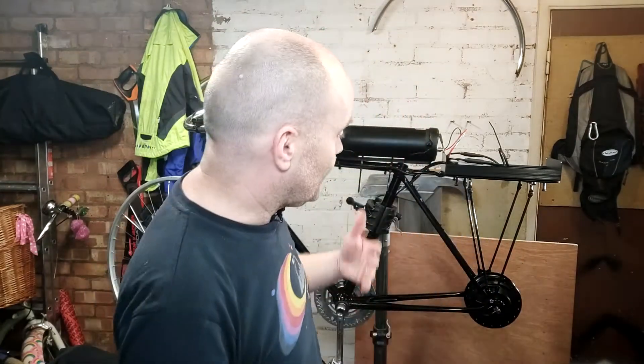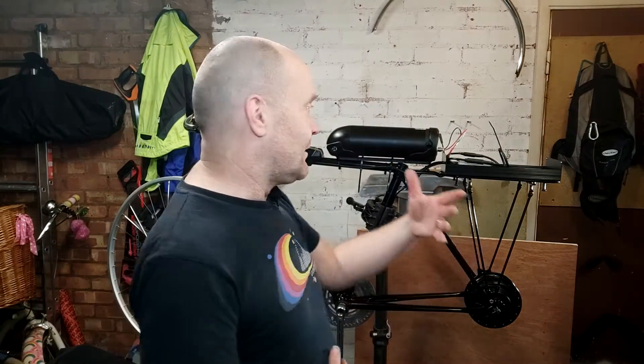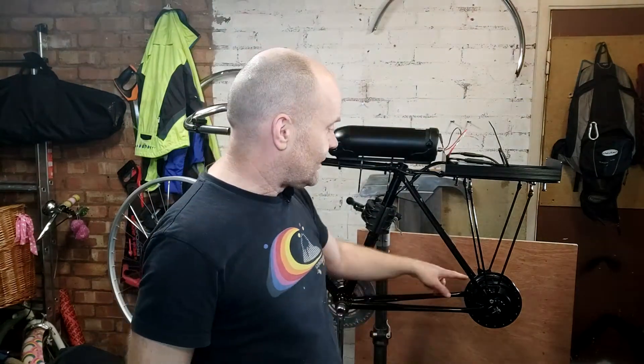To do those settings, one of the things I had to do was dismantle the hub — take it apart and have a look at how many magnets were inside it on the actual rotor, because a motor has magnets and coils. I counted the magnets, which is 20 in this motor, and I also checked how many speed pulse sensors there are. When you take the cover off there's normally a little magnet inside — you count those magnets and feed that information into the controller, which then uses it to determine the speed of the hub.